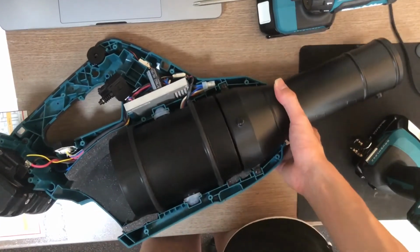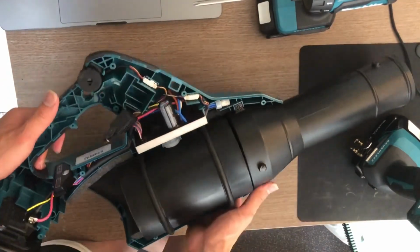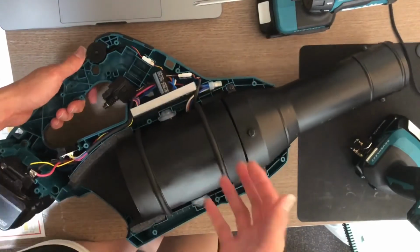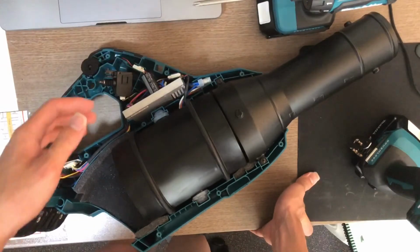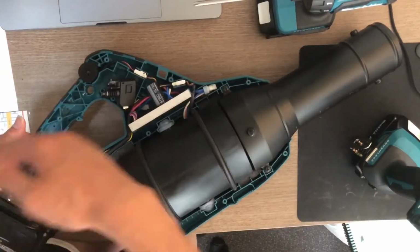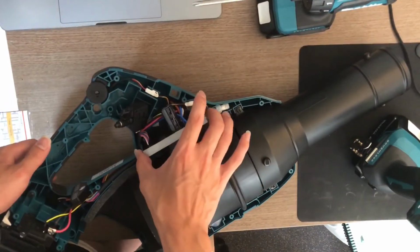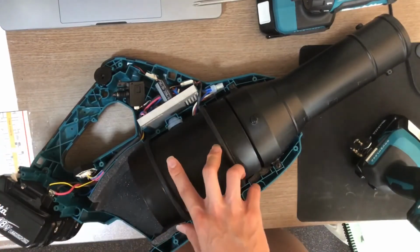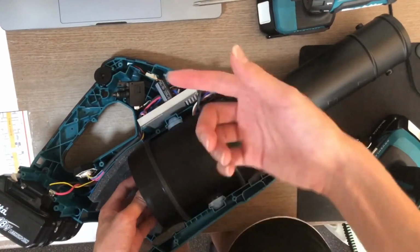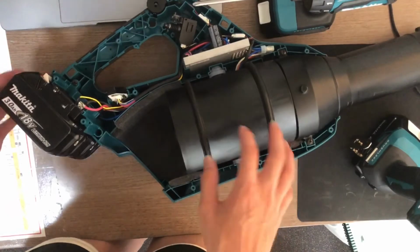So if the blower works for a long time, a few minutes later you will feel the whole body heat up, maybe to about 32 to 33 degrees, because the whole body is running in hot air. Yeah, because the heat sink and this circuit board get pretty hot, and the motor also, and also the blade at high speed has friction with the air, so it also produces heat.